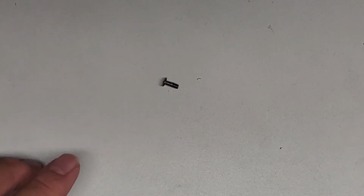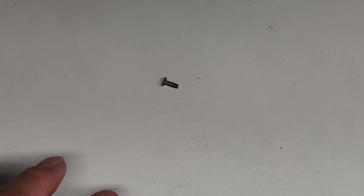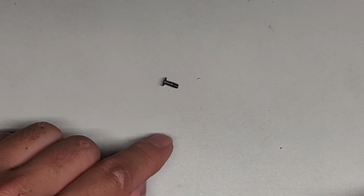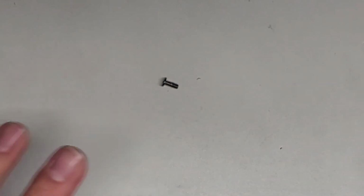You don't want to use it on all the bottom case screws. If you're going to use Threadlocker on the case screws, you want to use the blue stuff just because it's easier to get out and you have no reason to put the red one. And you don't want to risk putting a very strong Threadlocker when those screws, if you drop your laptop and crack it, then those screw mounts might pop out, and then it's going to be very hard to take those out. So use the blue stuff for the body and the red stuff just for the hinges, because the hinges have to handle a bunch more stress and shock.